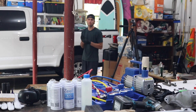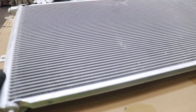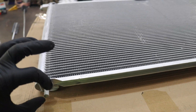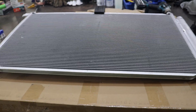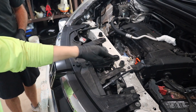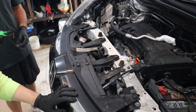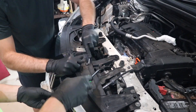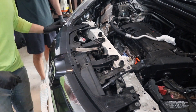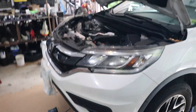Now that we have the compressor out, you could just put a new compressor in, but this car owner bought a kit that includes a new condenser. So we're going to put this condenser in — it looks like it slides into some lower holding grommets. Let's start disassembling the front end to replace the condenser. It looks like we need to take off a lot of these little plastic pop rivets and see what it takes.